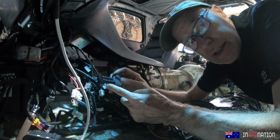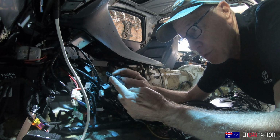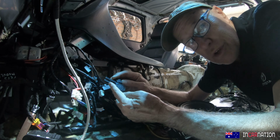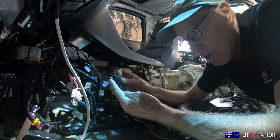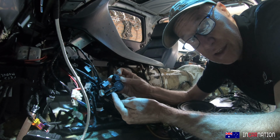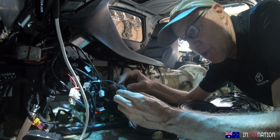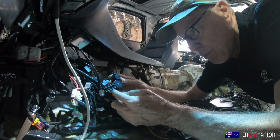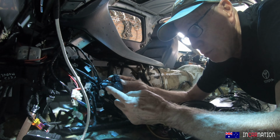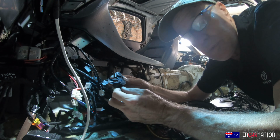So when I take this there. Evidently, I've got to find what the rest position is. When your foot's off the brake, it's probably somewhere about there. So now I have to go and find somebody else's MG and measure what the rest position is on the brake, and when you're at half brake and full brake, that kind of thing. And then fudge it somehow so that it thinks we don't have our foot on the brake while we're accelerating. It'd actually be quite hard to make up a bracket that mirrors the function of the MG, because the pedal shape and arrangement and bracketry is completely different from the Porsche.